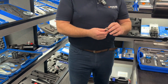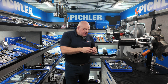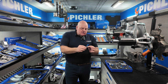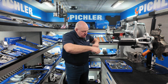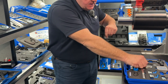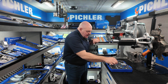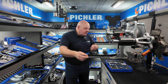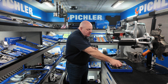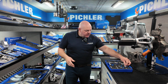The four clamps are all the same. When you want to follow a bendy pipe that goes left, right, up, and down, you take the old one off and want to make a nice one to follow it. You clamp this to your pipe — it's got two tube holes — so you clamp the original one all the way down and as you go you're working away with the pipe bender in here, and you can follow it along, clamp that one, get the next one, clamp it again. You're indexing into the original pipe all the way along, making a really nice tidy job of repeating the original bends.